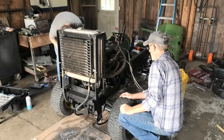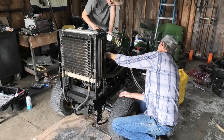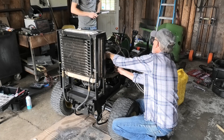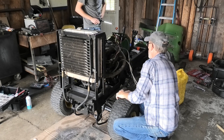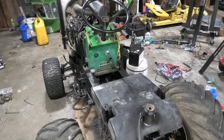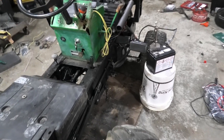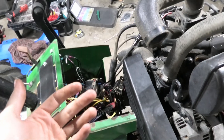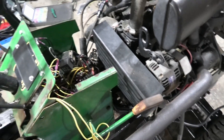Sounds like something's rubbing. I'm back — there's quite a bit more work I had to do to get it running right. I think I've got the wiring all figured out now. It was knocking pretty bad; it wasn't the motor — it was the drive shaft that I made since I shortened it. Part of the front U-joint was just barely rubbing on this bracket here that supports the steering gearbox, and I managed to get in there and clearance that.